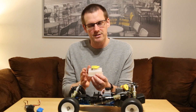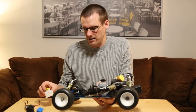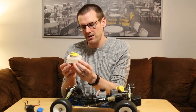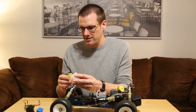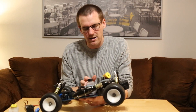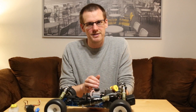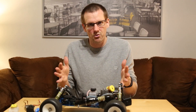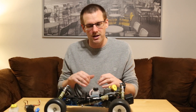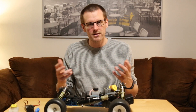That was very bad — it's probably one of the worst tanks I've ever seen for a radio-controlled application. I ended up replacing that tank entirely because it leaked out of the seam in multiple locations on the very bottom. So I replaced it with a tank from a Traxxas T-Max. The new tank is much bigger, so it should give a lot more runtime. It was also easy to fit within the location and space restrictions. I marked the location, center-punched it using calipers to align all four mounting screws, drilled it once, and it was good to go.